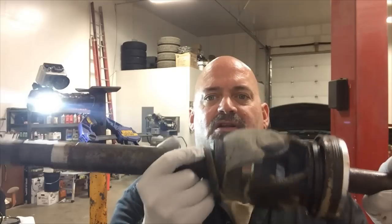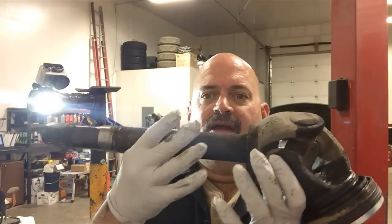I'm talking about the seal that's inboard of the front outer u-joint. It's always bad if it's two years old — it's basically a dust seal that seals the axle housing from dirt and debris. I'll put a link to the ball joint video in the description; if you're just doing the seals, you'll need to watch that video, which outlines removal of the drive shaft and replacement of the ball joints. This video focuses on replacement of that seal when you have the front axle shaft out.